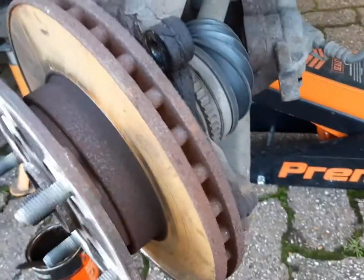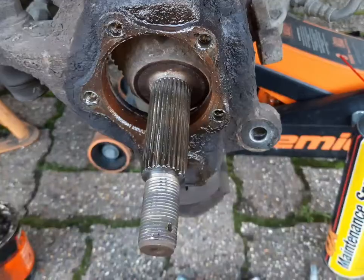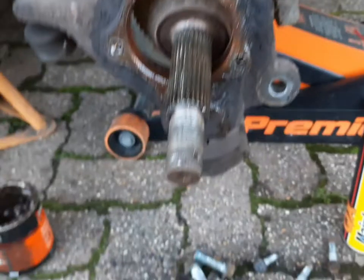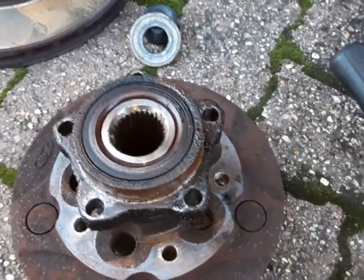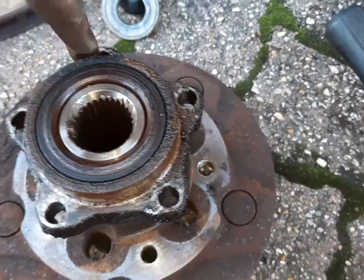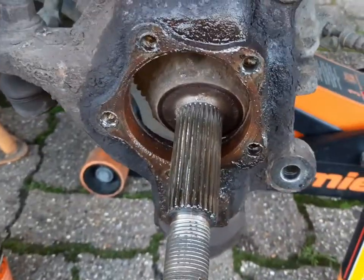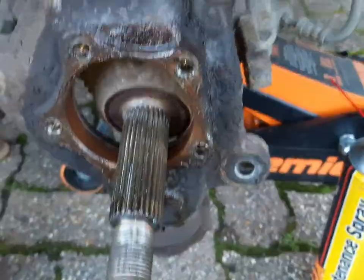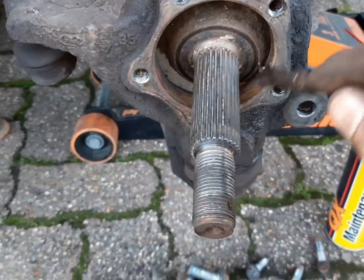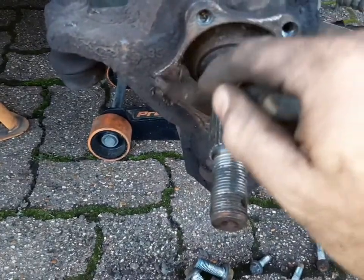And now it's the big time. You're going to give the back of the disc a hard whack, and then you'll see it splitting from the actual main hub, and it pops straight off. Just give it all a nice clean up. So just give this a good old clean around here — we've got some brake cleaner squirted all over it. This is some lube from trying to get it off. So I've cleaned it, a little bit of grease here and there just to make your life easier.